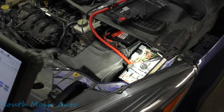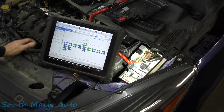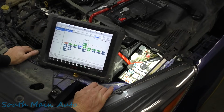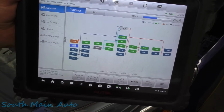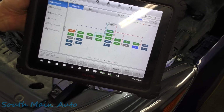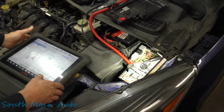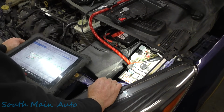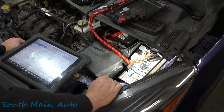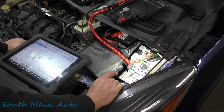Technically the car should start and run at this point. I mean, we did drive it in with that jumper wire in there. Yeah, it looks like so far just one code there in the driver's door module. It's probably because we got the window down or something. Okay, I think that gives us good direction. Customer helped us shortcut this one a little bit, which is great. Don't know how he got to his conclusion, but we're gonna steal it for now.